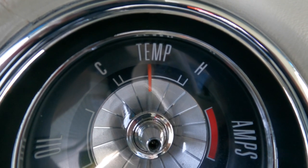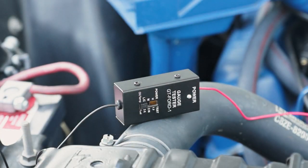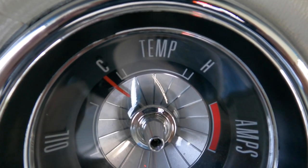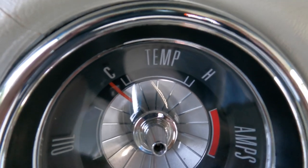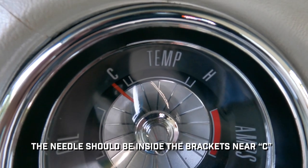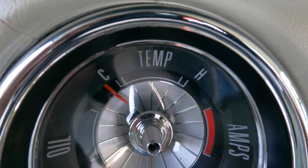Let's try the low setting. I've let that sit for a bit and now it's right down below the C. So it looks like my gauge is a little bit shifted towards the negative side — meaning all the way high doesn't go all the way to high, but all the way low goes below low. From that test, we can confirm that my gauge is actually out of calibration. I wish I would have known that when I was putting the car together and still had the whole gauge cluster out on the bench.